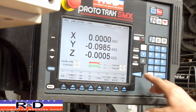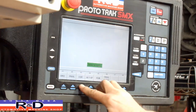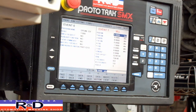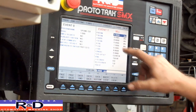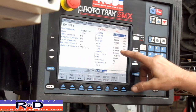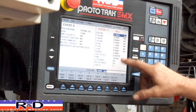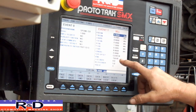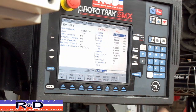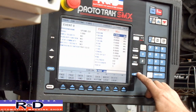I've written a simple one-line program for this. Basically it's beginning at X zero, we're going to go 48 and a half thousandths down in Y, Z is going to be zero. We're going to make the splines an inch and a half long, so X is ending at inch and a half, and we're going to wind up in the same place in Y — 48 and a half thousandths — Z zero, Conrad zero, center of the tool. We're going to run this about 150 RPM, and we've got our feed rate set at five. We may be able to jump that up a little bit more with the aluminum. Pretty simple one-line program.